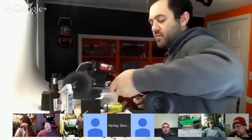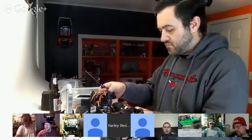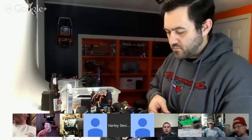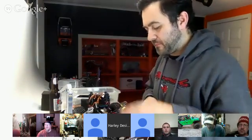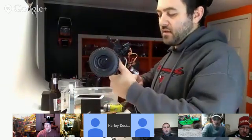What motor are you going to put in your Vaterra? I've got a Holmes Hobbies 13 turn in there now, and that's what'll stay. Okay. I was wondering, because on that post, it looked like you broke your stock diff gears. And then you posted the heavy duty version or whatever. Yep. Well, I blew up the stock gears with this motor. Oh, did you? Do you think the new gears are going to hold this motor? Yeah, oh yeah. It doesn't sound like people have been having a problem with these new gears. Is it mainly because they're supported on the backside now? Yes.